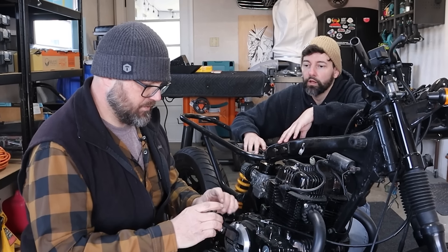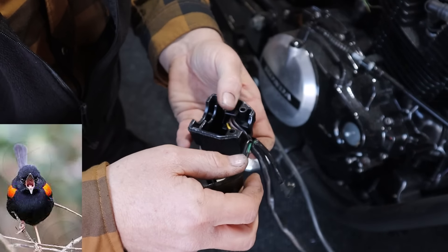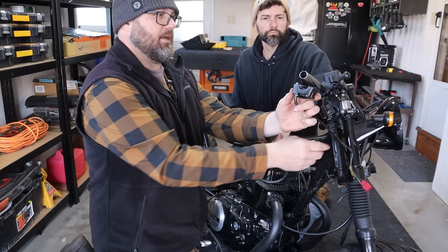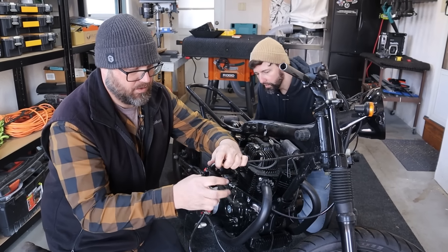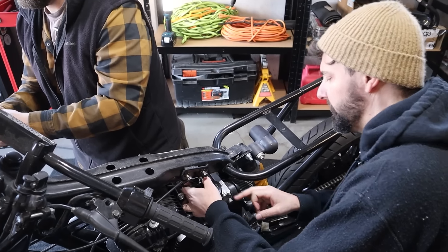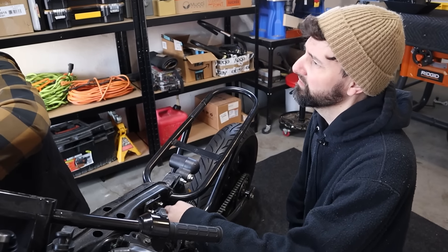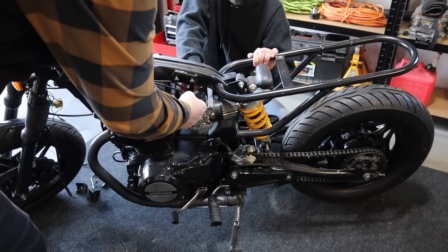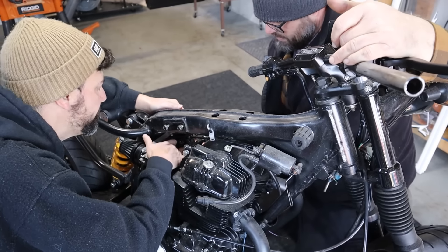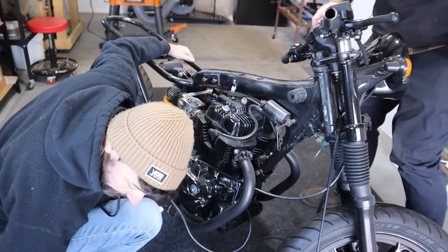How do they have these cables around? They're supposed to tuck in that housing and around the handle — they've always been a bit of a thing. Pull it off. You want to start pulling off down here? I think I can get to it with my skinny little fingers. I'll show you a trick. These cables have been the bane of my existence. So just unscrew that bottom lock nut, pop the cable out of that holder. Now you should be able to wriggle this around. We want to run this one instead.